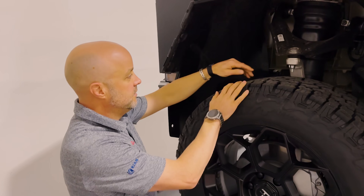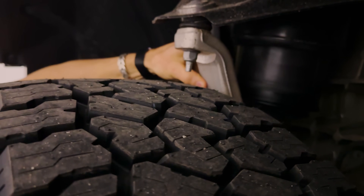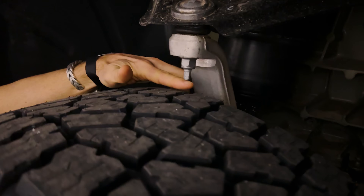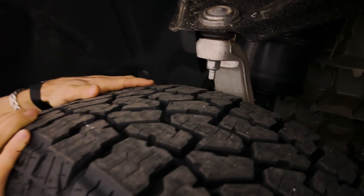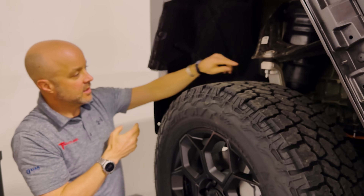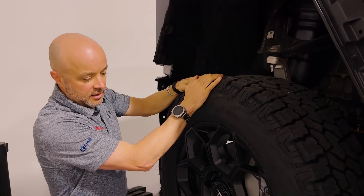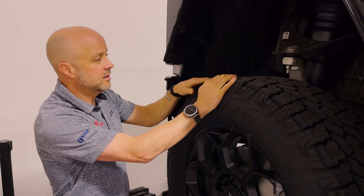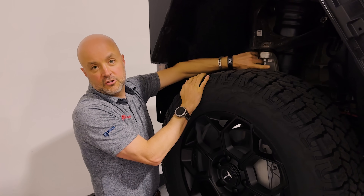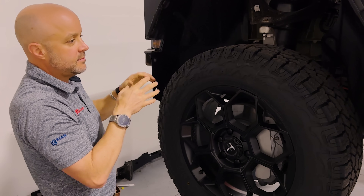It's a little dark in here, but if you look at the upright at the upper control arm, this nut that goes through is actually over the tire. So as far as how big a tire you can put on the CyberTruck with a stock wheel — without changing offset or moving things around — it's going to be minimally bigger than what's on there. We have an aftermarket Falken Wildpeak tire on here, but it's the same size as the factory Goodyear. You have less than an inch of clearance with stock fitment wheels.